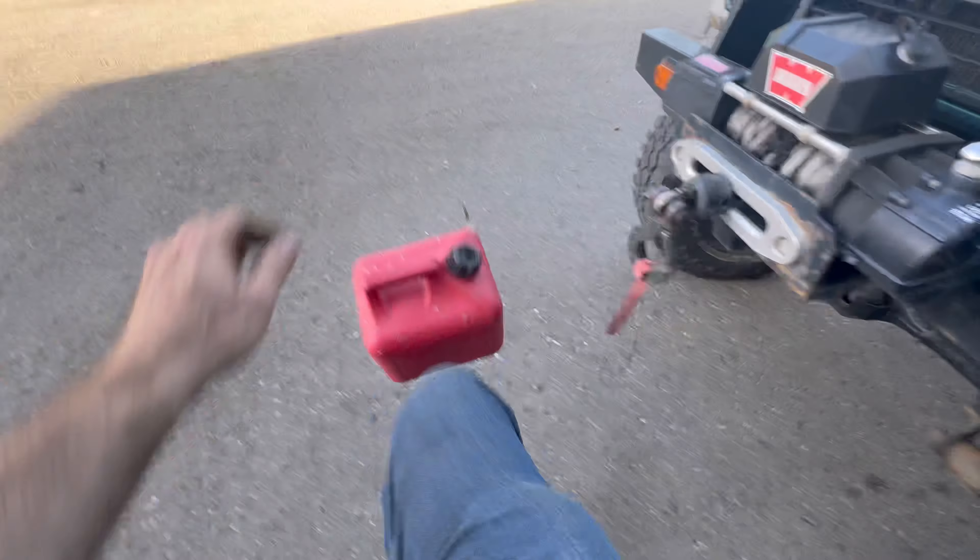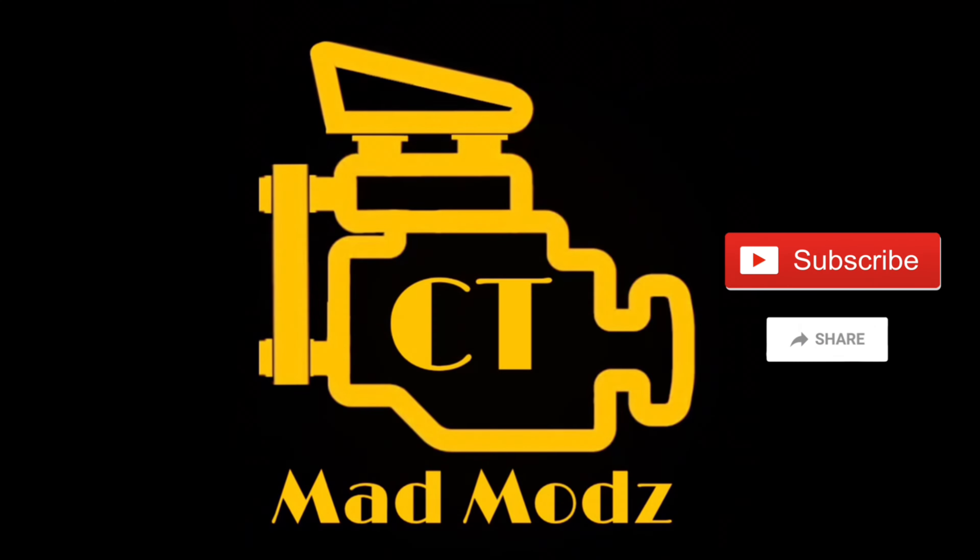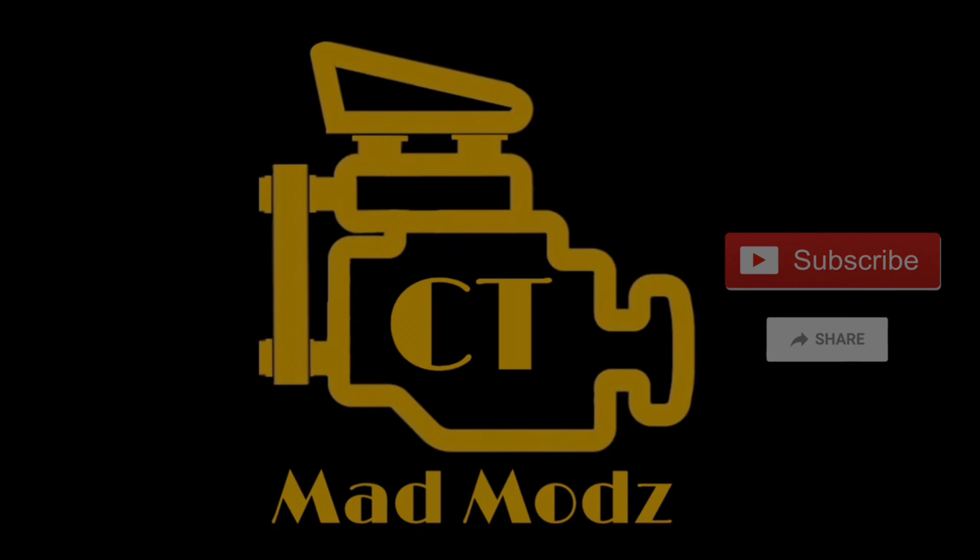That filter I used is a Wix 33296 — if you were wondering, it's just a high pressure fuel filter. I went to the auto parts store and looked for the biggest in-line one I could find. I used some hose clamps to put that together. Let's start this thing up and make sure it's not leaking. No leaks — she's ready to go. Got 15 gallons now. This thing gets horrible gas mileage — I make like 9 miles to the gallon and literally run out of gas in about 100 miles with the 10 gallon tank. With 15 gallons, I'll be able to make it 150 miles now.